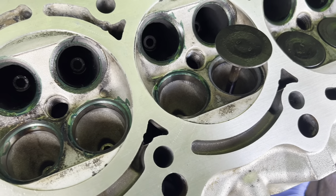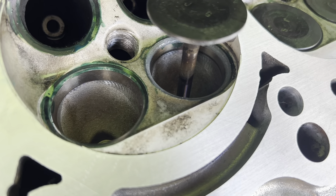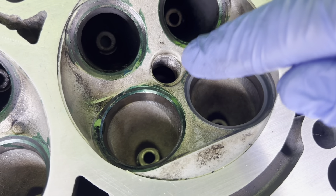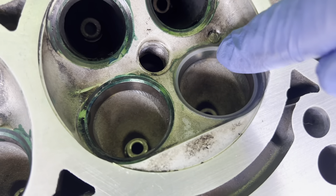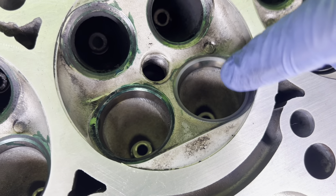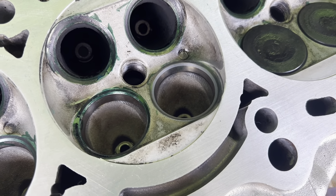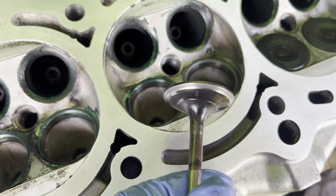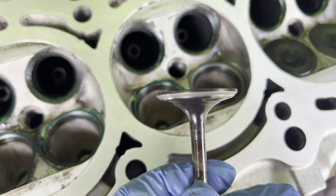Push that valve back out and see right there — you can see how wide your seat is. Now we'll check and see how the Sharpie looks. You can see in there how wide, nicely, and uniform it is. No pitting areas, nothing like that — it's smooth, and you can see it's even contact all the way around. Now we're going to check the bottom of the valve. The bottom looks the same way — nice wide contact patch, no major pitting. It'll make a nice, good seal. If you don't have even mating surfaces and a wide contact patch, you might want to look — you could have a worn guide or a bent valve.